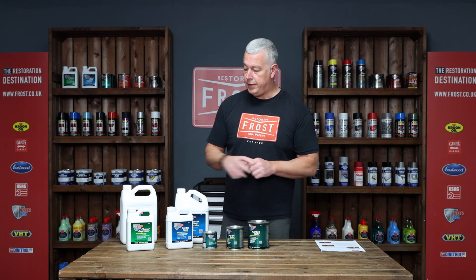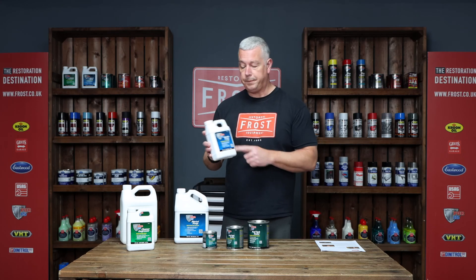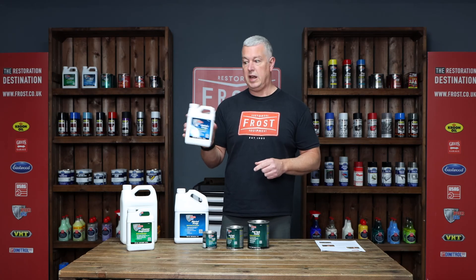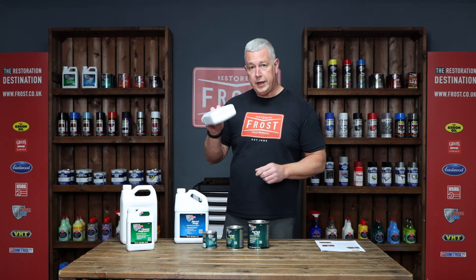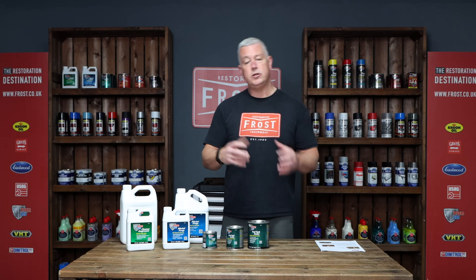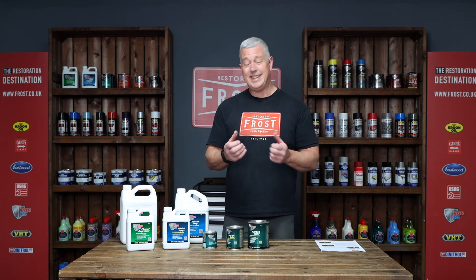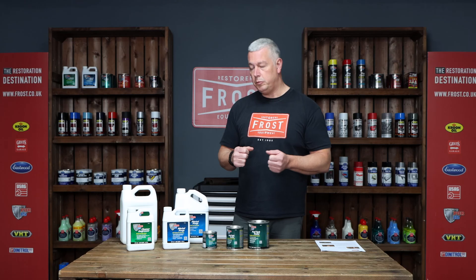When you've got the tank clean, your next step is metal prep. It's a water-based solution — liquid zinc phosphate. It looks like blue water. Pour all of it into the tank and leave it for ten minutes, then turn the tank, give it another ten minutes, and turn again. You want this solution in for 40 to 50 minutes. All you're doing is imbuing the inside of the tank with zinc phosphate, which is essentially the primer and adhesion promoter.